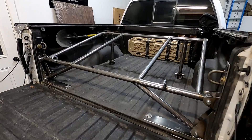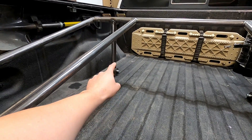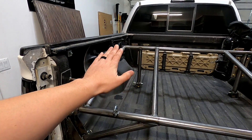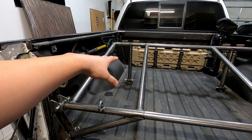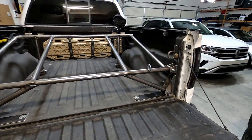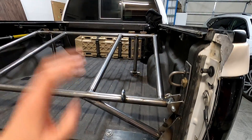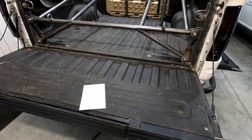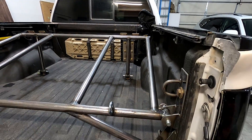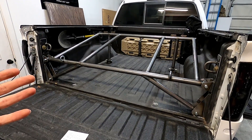This made it out on its maiden voyage on the last raptor run and seemed to work really well. This is actually version two — my first version had a long strap of metal going from the bracket all the way down to the bed bolt, but it was trying to kick up and pulling the 3/16 plate off the bed and flexing it. That's why I went to this version where I drilled through the bed. Having this bar low makes it really easy to get the tire in and out — I can do it from the tailgate without climbing up into the truck. I just plop the tire in from here, which is super easy.